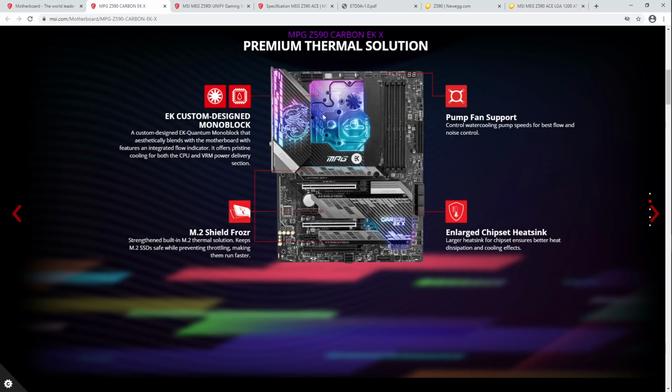Honestly, water cooling makes a lot of sense if your VRM is garbage. It doesn't make sense if you have a high-end VRM. So even on a board like this, it's still arguably not really doing anything to water cool the VRM, but it's doing more than if you did the same thing on a Godlike, because on the Godlike, that VRM is going to sit basically at the same temperature as whatever your ambient air temperature is inside your case, regardless of workload. Whereas here, the VRM might actually run 20 degrees above ambient. So, the water block actually makes a difference for once.